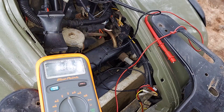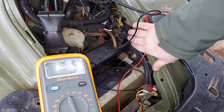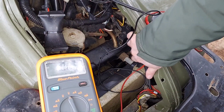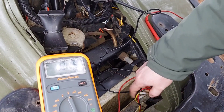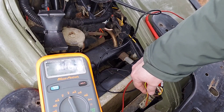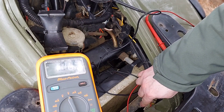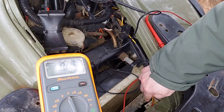We're up front and we're going to be testing the AC voltage coming out of the stator assembly. The stator assembly has two yellow wires that run up along the frame in this loom and they come up here to the voltage regulator, which is mounted to the frame. I have it unmounted right now — it's held in by T27 bolts.